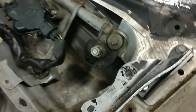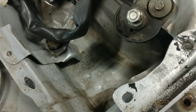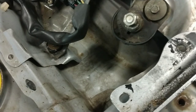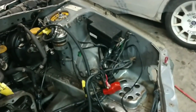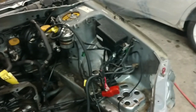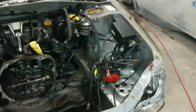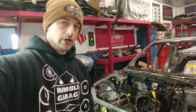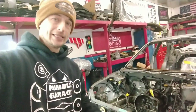As you can see, there is some staining from all the dirt and grime that has been sitting there and accumulating for so long. You can go in there later with a wipe or even some acetone to clean the entire surface so that it is ready to put a grinder or welder to. In this instance, we're going to take the Rumble Garage tub kit, place it, trace it, cut it, and weld it into place once everything has been cleaned down to a nice clean surface.